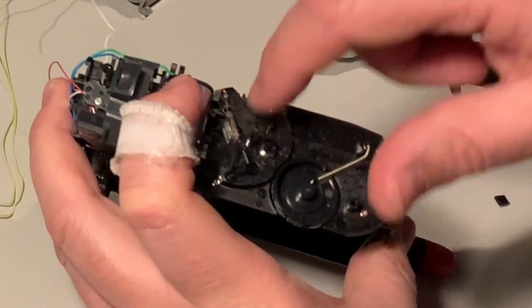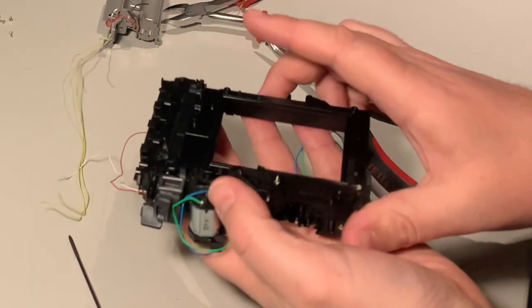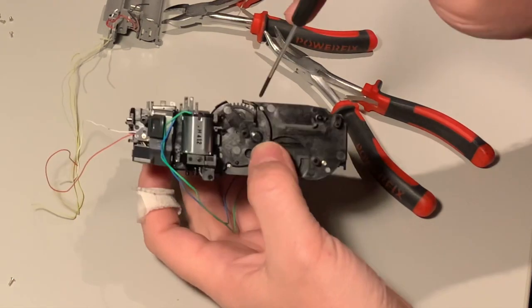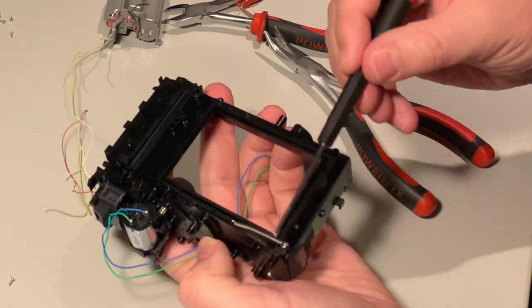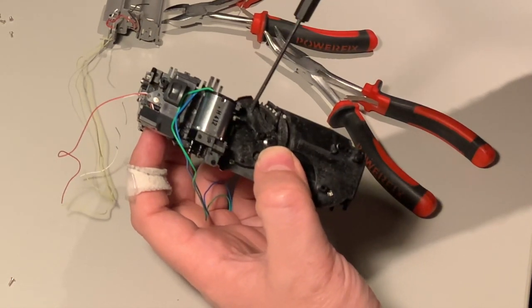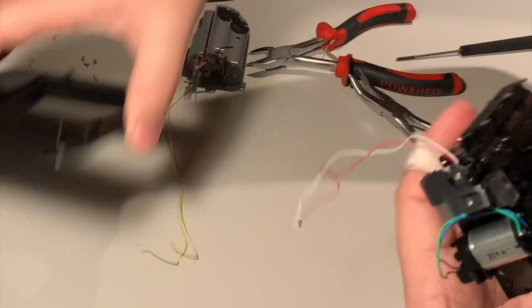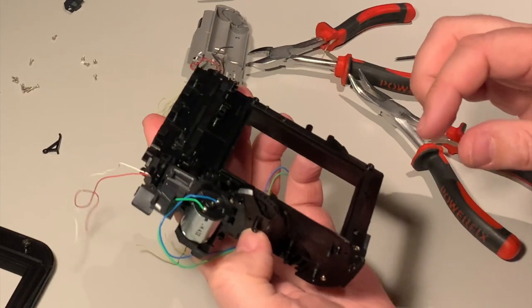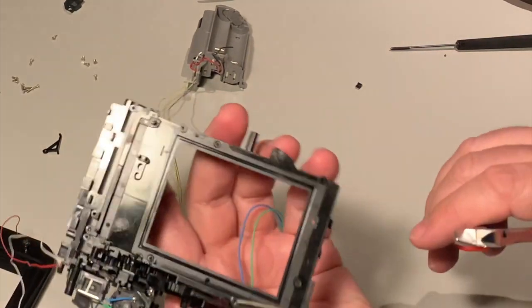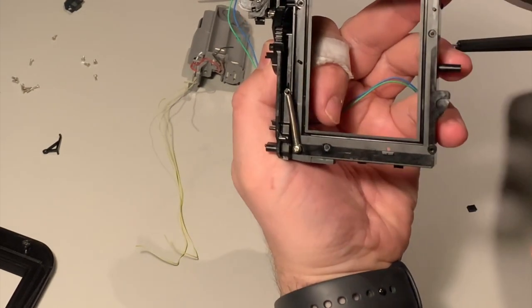This little thing manipulates the switch. Let me do a quick recap: I have moved a little screw — this was basically holding the lens to the camera. I removed a screw here because I will be trimming off all this as far down as I can. Don't trim the sprocket, but try to trim all the plastic here so it can fit inside this little cave. I also moved the spring — it was attached up here, now I attach it here with a screw.